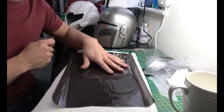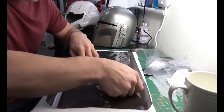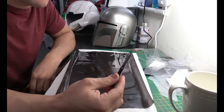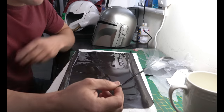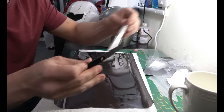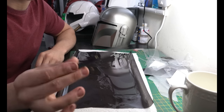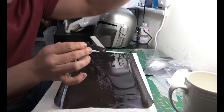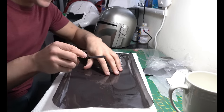And you can never put too much water on this. I put how much I felt I needed, and I was happy with that, but you could definitely put more on there. The other key thing when working with window tint or any type of vinyl, get a fresh razor, get something sharp. Don't skimp out and use your completely dull X-Acto knife because you just don't want to waste a blade. Just save yourself the hassle. Typically the window tint kits come with really nice razors. I've never seen a switchblade razor like this. This is actually kind of funny. So make sure you have a really nice good blade on you, but again, be careful.